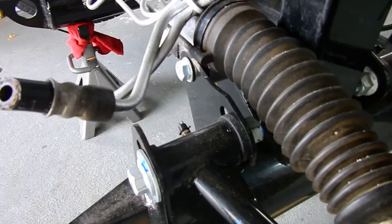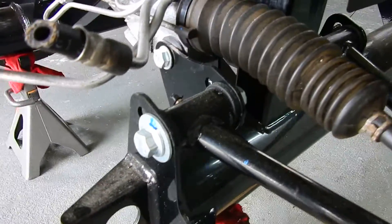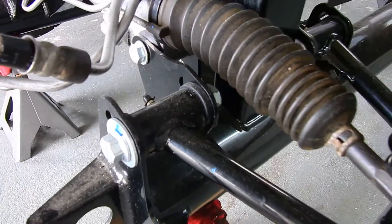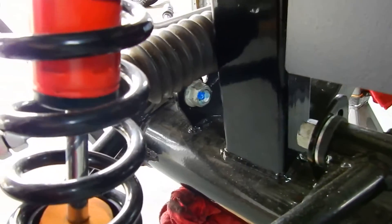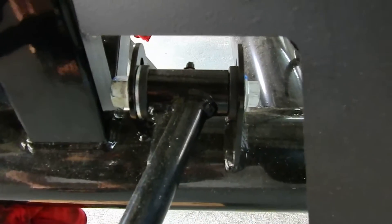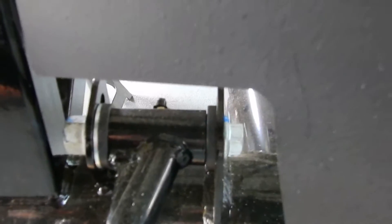For the lower control arm bushings, I extended the steel bushing inside in order to be able to reach the metal flanges. I've also torque-marked them — I've never marked anything for torque before so I realize that may not be on the right side, though I've done it on the other side as well. The outside would be a little easier for appearance.